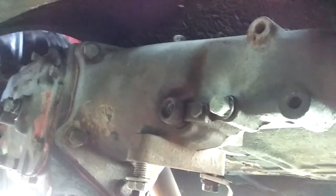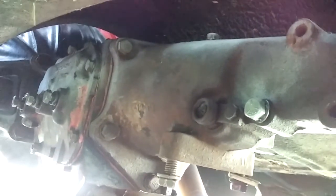My old shifter — what was happening is none of it was right. When I bolted it all up, it was rubbing the floor about right in here, you can see where it was rubbing. What was happening is that old shifter had like a spacer under it and it was raising the transmission up too high, and it was making it rub.